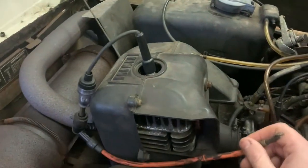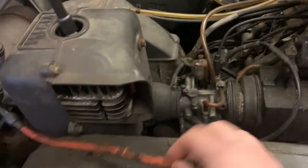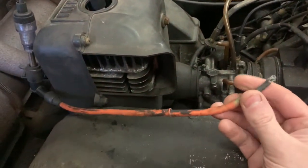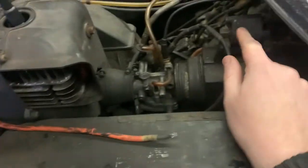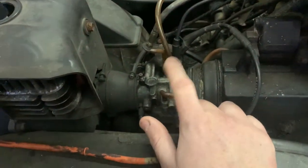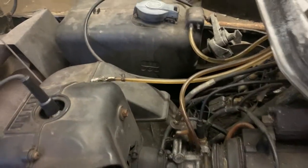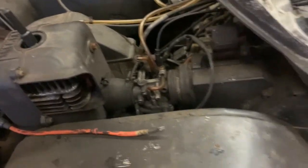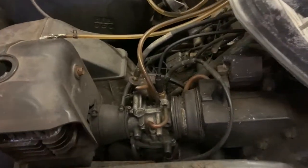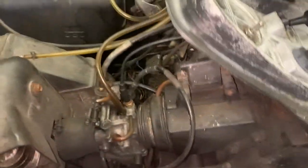Nonetheless we'll keep on doing the work. What I gotta do today is see if I can fix this with a bit of glue or JB Weld for now, stick it back in there until he gets another one. I'm gonna take off the carburetor, give the carb a clean, get some new fuel in the tank, see how she runs, and start buttoning up a few more things. Let's pop off this carburetor and see what we can do.